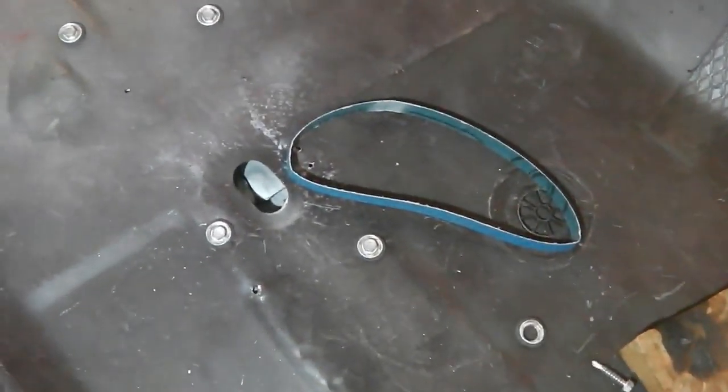Okay, that's all the tech screws in, and now what we need to do, I've drilled through all the remaining holes that are already in the chassis leg, so they come exactly into the floor pan where you want. So what you do now, we just put the spot weld drill bit in these. We don't want to use a normal drill bit because that'll damage the chassis leg, so we just treat it